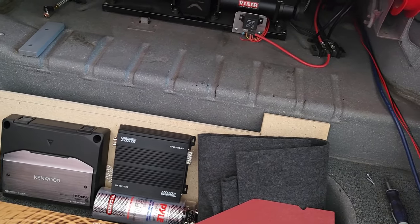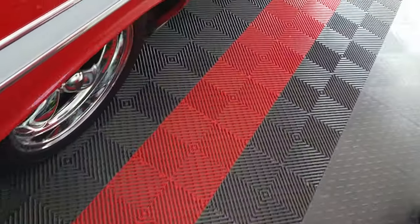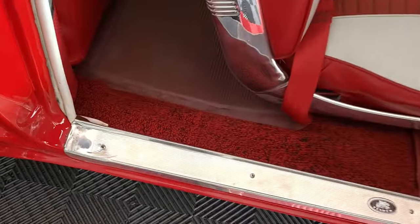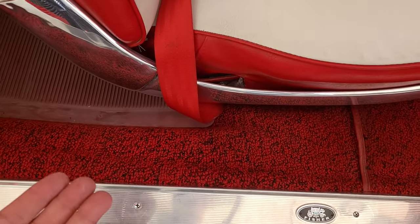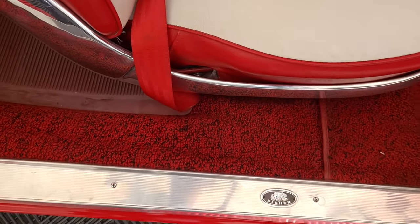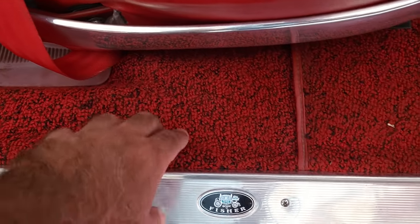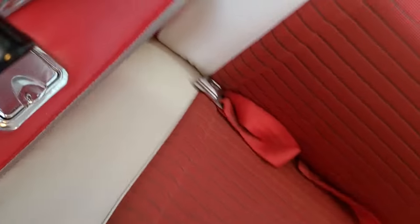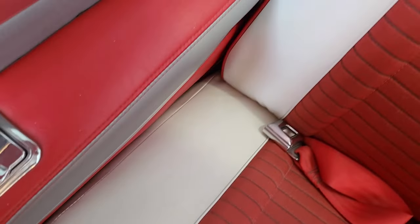All right. What else am I going to tell you before we get started? The cabling is really cool, really easy. For the sill, you just take the screws off, the sill pops right out, and you put the cable underneath the carpeting. There's a little channel right there that helps with that, so you don't even see the cable. This bump that you see there isn't the cable, it's actually the channel. So route the cable underneath, and I tuck it between the seat and this armrest, all the way down. You see some of it coming up there, but you can push it all the way down.